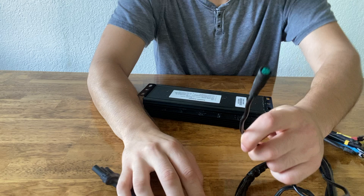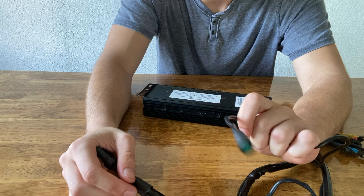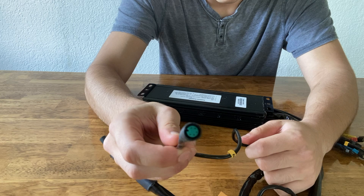The next wire you need to worry about is the hall sensor. That goes to the motor as well and it tells the motor what direction to go when you throttle it. If you don't have this wire on a controller you got for an e-bike, it means you have a sensorless controller. Sensorless controllers are way less efficient — they're not going to be as smooth on takeoff. It's just a way better experience to have this. Sensorless is just old technology at this point.